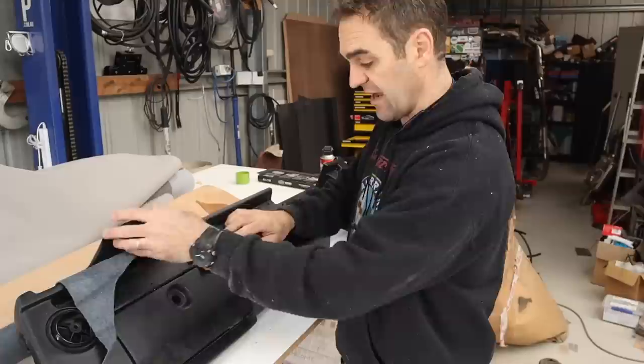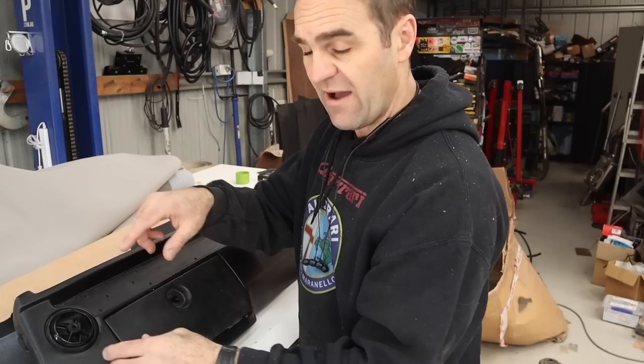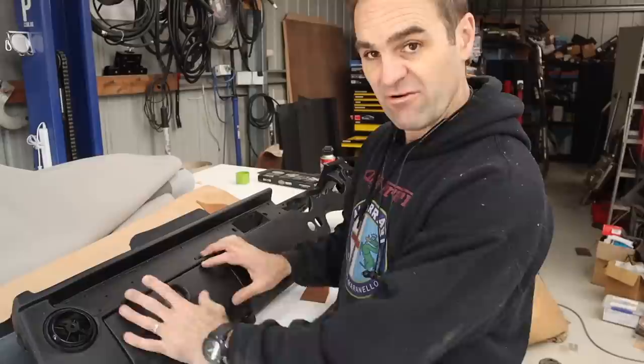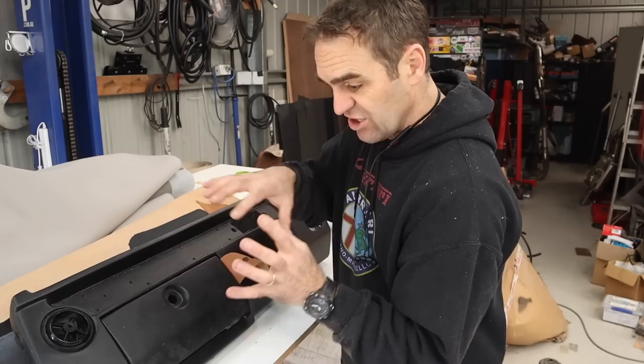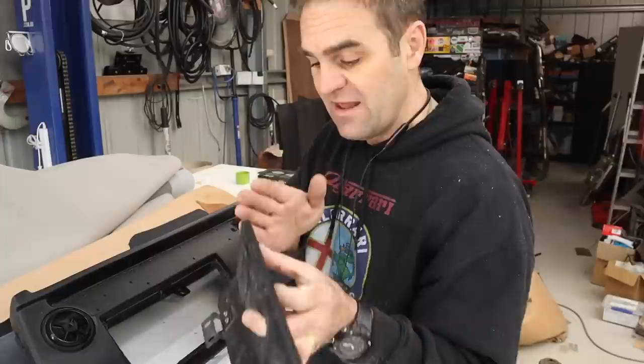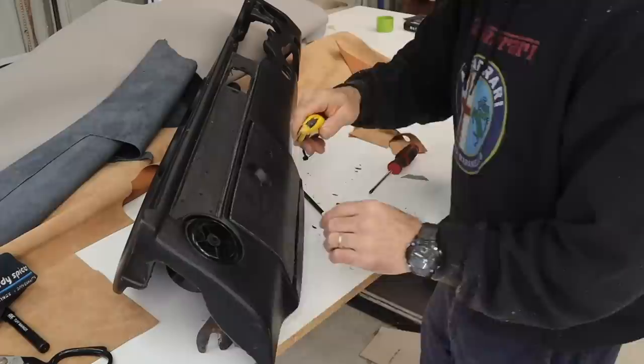What I'm going to do first is look at how I'll fit the vents and glove box because you can't just wrap these in leather and hope it still works. With the extra thickness of leather around the glove box, once I've got two layers on both sides, you're not going to be able to fit it back in again. So I'm going to have to trim the edges back all the way around to make it a little smaller and give space for the leather wrapping.